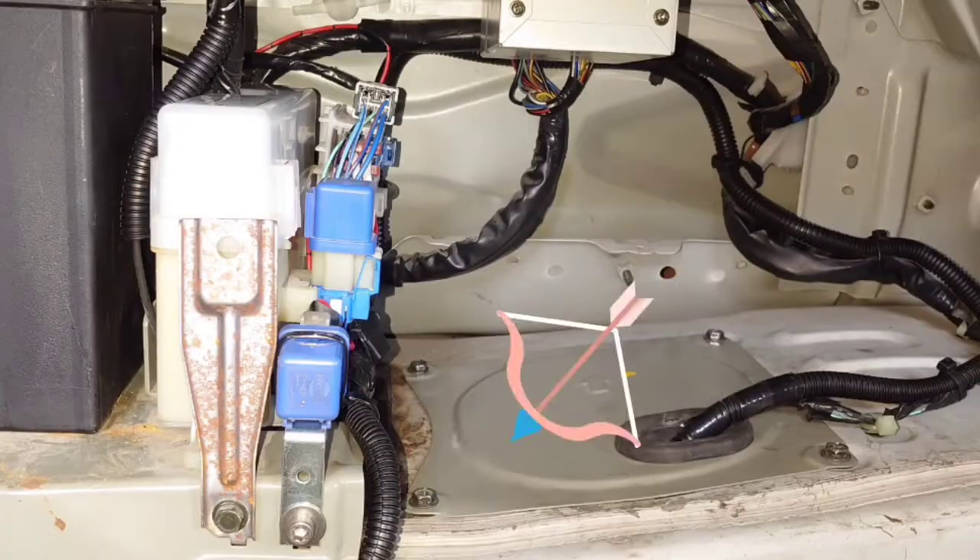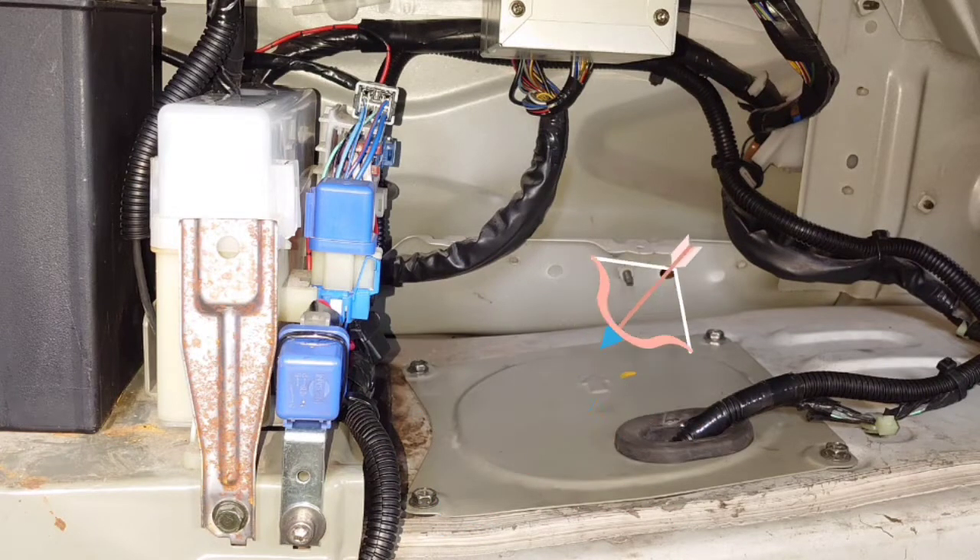When I tested this car a while back, the fuel pressure regulator was obviously out. Coupled with fuel control issues, the easiest and cheapest mod you can do for an older car is the 12-volt fuel pump mod — meaning your fuel pump is going to get a full 12 volts on a relay system. Make sure everything's good to go.